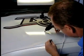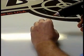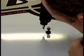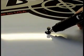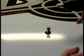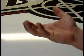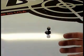I'm going to find the dent again. I also went to a smaller tab because the first pull actually made the dent smaller. I'm gluing around the whole tab — these are our star tabs, designed by us. They're designed to embed themselves into the glue. Unlike the round mushroom-style tabs where you're only sticking to the surface, with our star tabs you glue over the top of the fingers and it webs itself inside the glue for a much stronger pull.